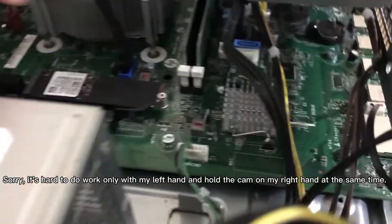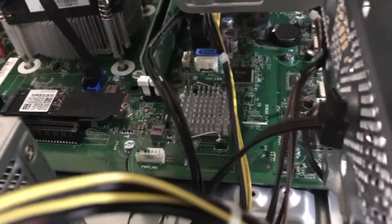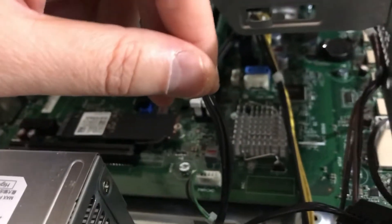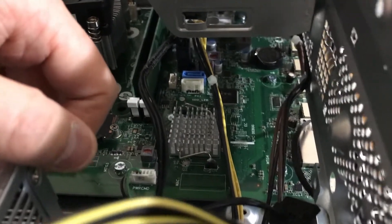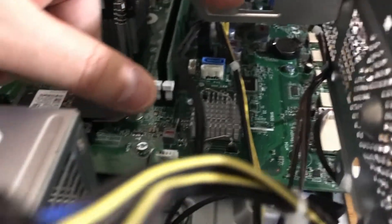You can see there's one blue SATA port that I will use, and there are two more SATA ports in the back — one light blue and one white. If you want to add more devices, you can as long as they are SATA devices. If they don't use much power, you can use a power splitter cable to make two more plugs to connect two more SATA devices. This case is quite small, so space is limited. If it's an SSD it doesn't vibrate or spin, so you could duct tape it anywhere. In the metal frame you could probably install one more SSD in the back, and the black mesh could hold something as well — so there are options.